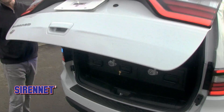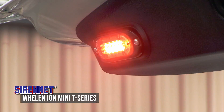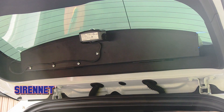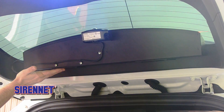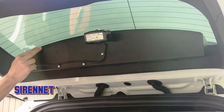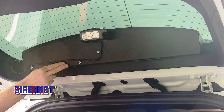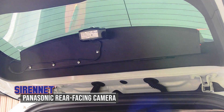To supplement the lighting when the hatch goes up, T-series in their miniature format have worked out really nicely. The RST in its one-piece housing is a perfect form fit for the Dodge Durango and other vehicles alike. The bracketry is very specific — the contour of it with the included lip piece keeps it from chattering and prevents light bleed inside the vehicle. It's also a great place for mounting accessories, in this case the Panasonic rear-facing camera.